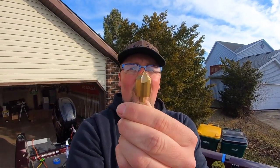Essentially, we are going to taper out the edge of the holes using this chamfer bit. I'll have a set linked below — you can get a set of six of these for about $10. If you're going to do any kind of modifications to your fiberglass boat ever, you owe it to yourself to spend $10 on a set of these. They'll last a very long time and save you so many headaches.